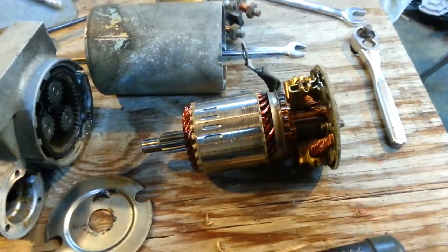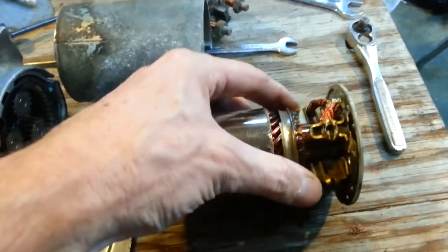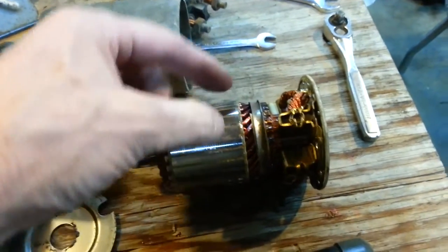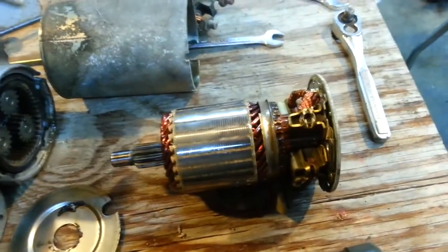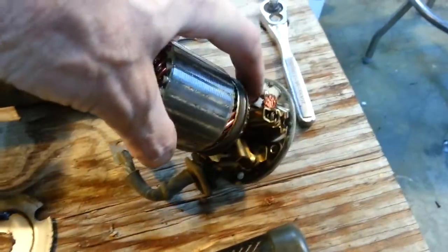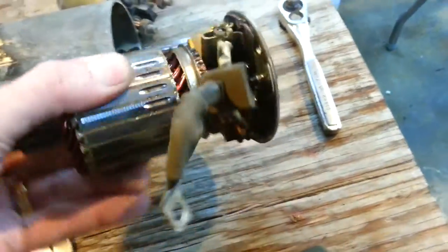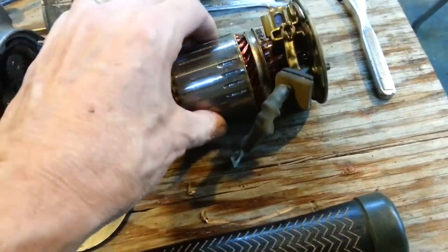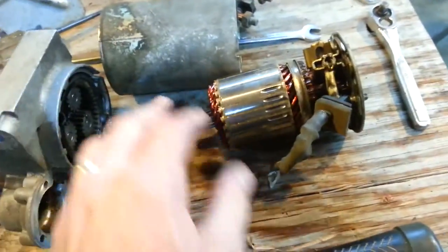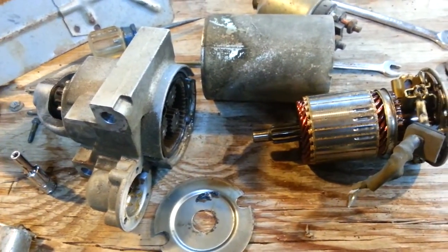You'll just click, click, won't start, but you tap it and it'll start. If one of these brushes loses contact, you'll get that same symptom because the current has to flow through. If you get a brush that's worn down enough and you tap it and it starts, you might think it's the solenoid — but it's actually the brush. You can get a set of brushes relatively cheap compared to a whole starter. Just buy this little plate here that unbolts, put that back on for maybe 20 bucks or so when everything else is still perfectly good. Rebuild it yourself and you've still got a high-quality original-component starter — you don't know what you're getting from aftermarket Taiwan or something like that.